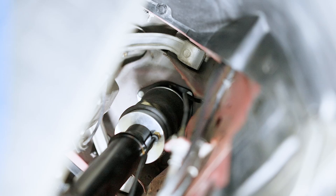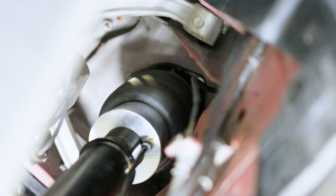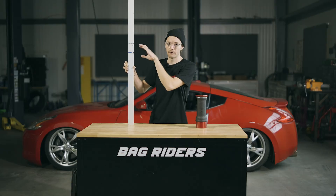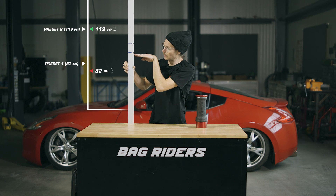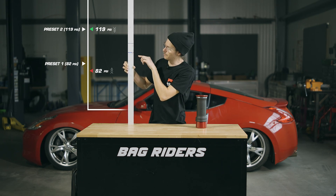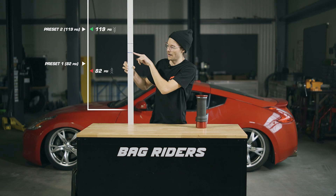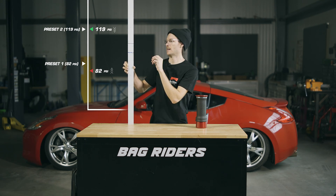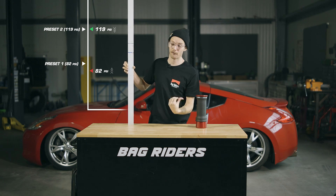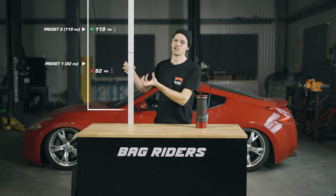It actually takes additional pressure to pull the sleeve bag and fully unroll it. That's why you get a totally different result going from a high height down to your preset versus going from a low height up to your preset. It's also why the miss is bigger at the higher preset than the lower one — because we were at a pretty low height at preset one. When you need to fight that sleeve bag so it fully unfurls itself, especially on a car where the sleeve bags are up front, that's where the issue occurs. The sleeve bag needs a lot of pressure to unroll all the way — you might hit the target pressure but not the target height.